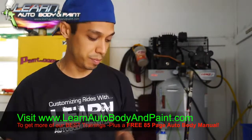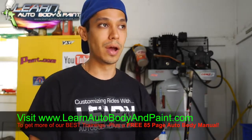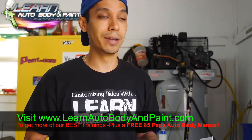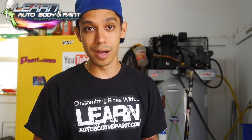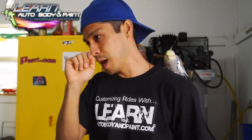Next one: I just did my first paint job on a 1990 Chevy pickup and it was orange-peeled. I'm doing my Mustang next, so how do I figure out the right air setting on the gun to get away from orange peel? Orange peel can be caused by a few things: pressure, a bad spray gun that's not atomizing your materials correctly, or the material itself. If you have a cheap spray gun you're not going to get the best results. That's why people pay six, seven, eight hundred bucks for a SATA or an Iwata, or you can check out the Learn Auto Body and Paint store and get a Warwick for two to three hundred bucks — excellent guns with high atomization.